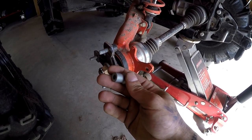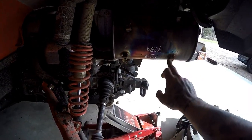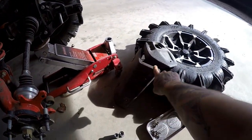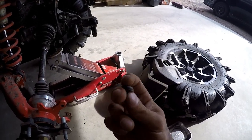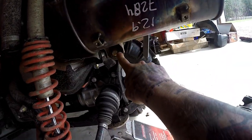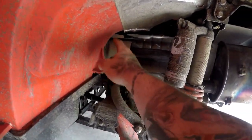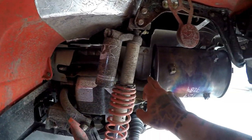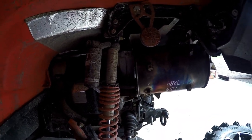There are four Torx bolts here and also another three on the back of the exhaust - these two plates here. They are various length T30 Torx bolts. Once those are out, you'll see mount number one and mount number two. We'll proceed to take those out, and then there's the clamp over on this side where it actually slips on. I'll refer to the instructions because, from what I've seen in other videos, some of the shield you have to adjust.